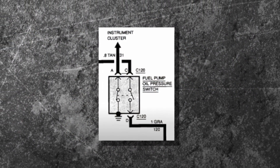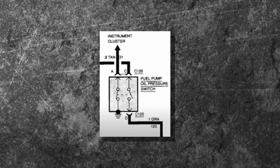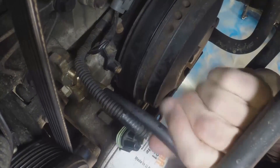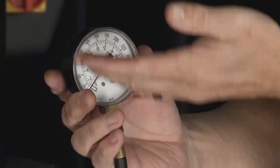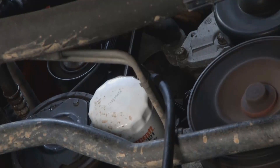Right here is an electrical gauge. It uses electrical signals, so that could fail and you may still have oil pressure. What you want to do is run a manual oil pressure test. Just look at your manufacturer's specifications, find an oil plug in there, pull out your sending unit, put your gauge in there, fire up the vehicle, and read your oil pressure.